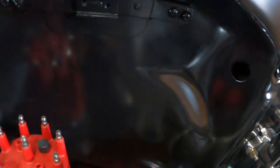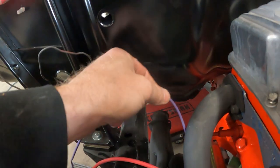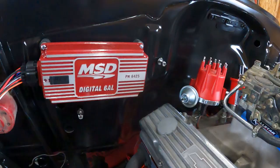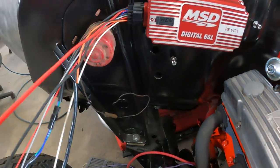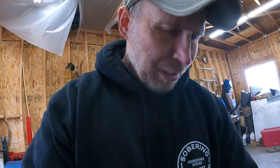I'm going to have a big group of wires come through right here and sneak them up and strap them up here somehow, so they're all out of the way. I'm not going to have any wires going across the top of the firewall or behind the engine — I'm going to send all of them inside. Even the ones that go to the distributor and coil: rather than having those wires coming down outside, I'm already going to have wires coming out of here, so I'm going to send them inside and then send them back out together. Ground, ignition, tach, distributor, coil — this has to also go in with this group of wires into the fuse blocks. At least I have a plan. Next plan of attack is I've got to drill a hole right there.